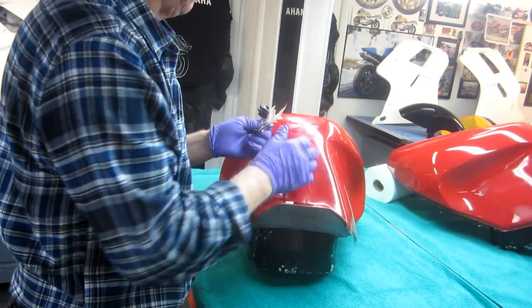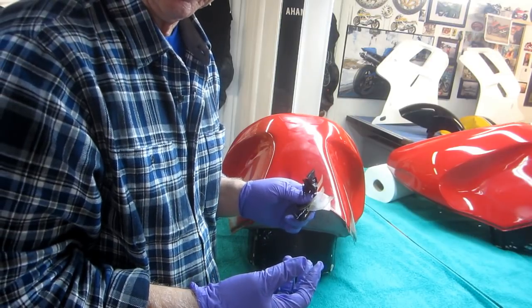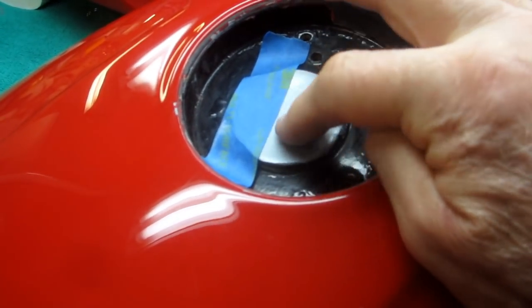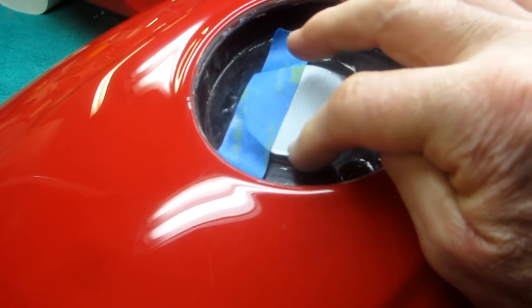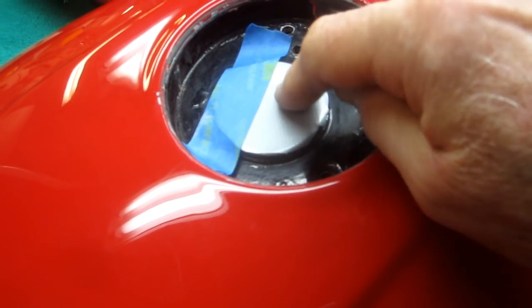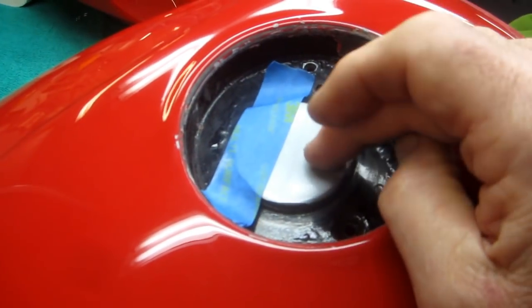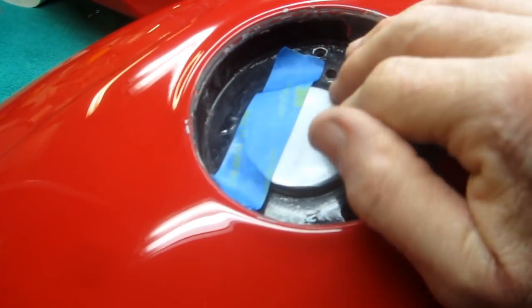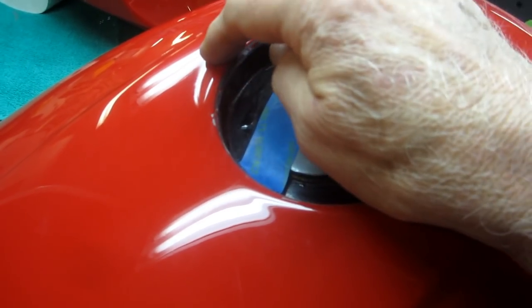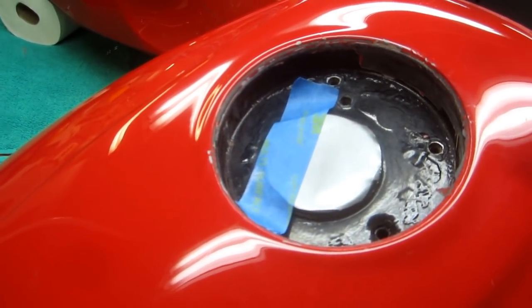In sealing up the cap, here's a good trick that will save you some grief: I always put the Gorilla Tape down first — that seals it. Now I'm done with the heat gun, so I don't want any paint remover getting down in there. But also, if you notice, paint doesn't really stick to Gorilla Tape. So what would happen after sanding is that chunks of this paint would wind up somewhere. The answer is paint sticks to blue tape, and there's less chance a little chunk of it is going to come off and wind up in the paint job later. That's what I've been doing lately and it seems to work a lot better than just using Gorilla Tape.